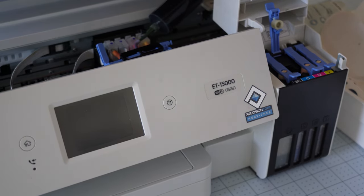All of the sublimation ink is out and my printer is just printing with the new Epson inkjet ink I installed. So if you're trying to swap sublimation ink for inkjet ink, or vice versa, this is possible. It may seem a little overwhelming at first, but using the supplies I recommend it ended up being a lot easier than I anticipated. Check out the supplies in the video description — including the big syringe which made this process so much easier. If you have any questions drop them in the comments. If you found this video helpful, please like it and consider subscribing for more sublimation tutorials and craft videos. Thanks so much for watching!